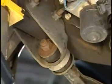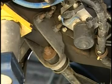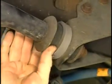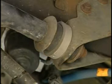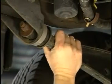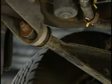Radius arm and other strut rod bushings mount through a hole in the frame or through a bracket. Inspect the radius arm bushings for rubber deterioration and large splits or cracks. If you find a shiny area, the bushing may be worn where it passes within the mounting hole. Check for vertical looseness. If there is a braking or handling problem, physically disassemble the bushing and inspect it for signs of internal wear.